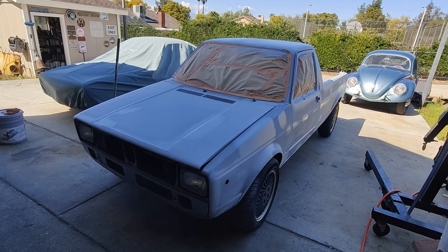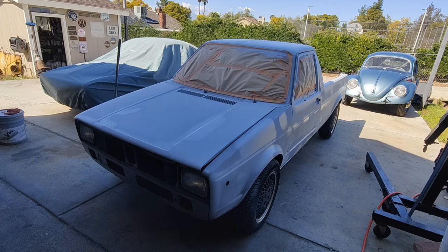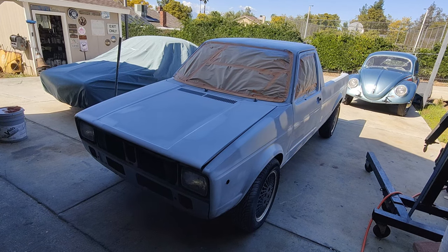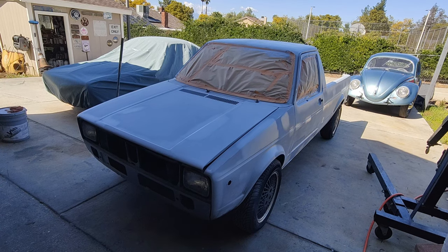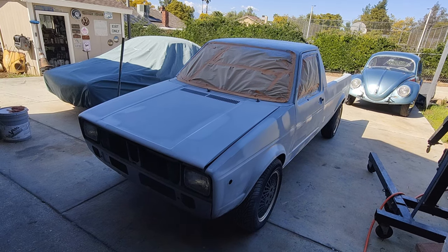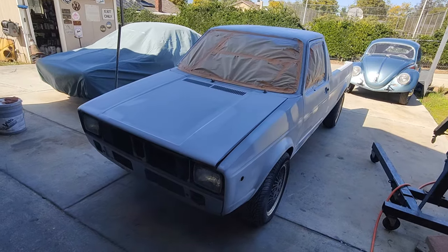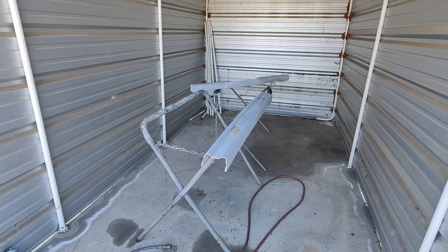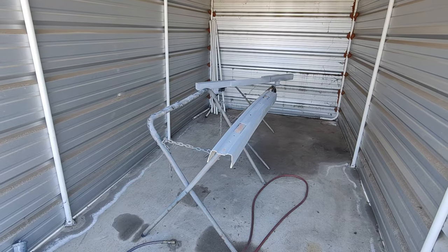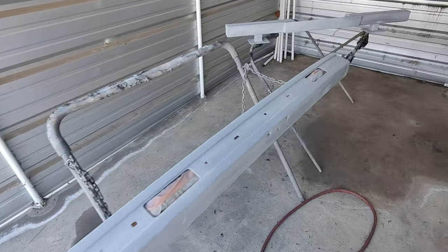It just lays down like the old Centauri. If you've ever used DuPont Centauri back in the old days and you liked the way that stuff sprayed, and you want a clear that sprays like that, that's pretty much what this one is. It takes a little bit of practice to get used to, but hypothetically, somebody could do that. My little spray area got a little bit of wind today, so I think if I'm ducked in here, it'll be all right just to get these bumpers done.